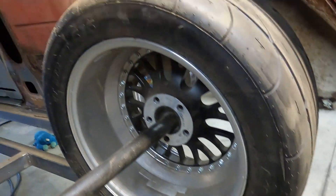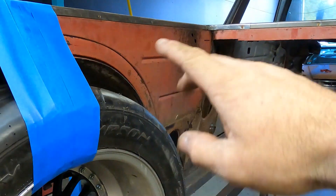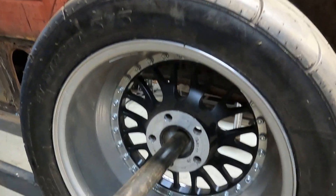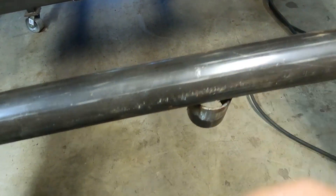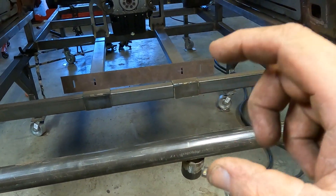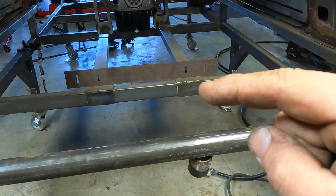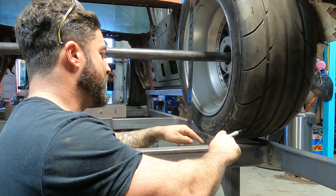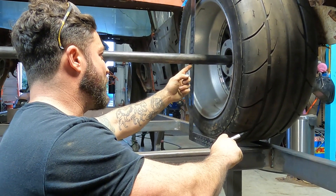I made a mess doing that rear end. What I'm going to do is eyeball where the center of my wheel well is, find out where the top of the arches is, mark it, and make my measurement from there. I'll make one from the back of those walls since I know that's exactly the same, and then we have our dead center. I found a tube that perfectly props the wheel up - so no more tape, we're moving up in life. I'm going to mark how far forward this tube correlates with the chassis and base my height off of the actual diameter of the tire.